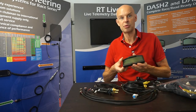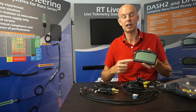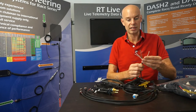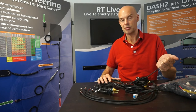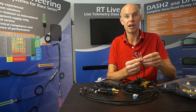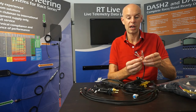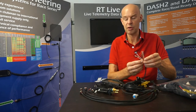The Dash 2 and Dash 2 Pro are both road legal. We have LEDs across the bottom for things like indicators, full beam, and handbrake switch as well, and those are brought out to these wires. For race applications that can typically be disregarded, but for road legal applications — for anything that's got to pass an IVA or an MOT test — these are wired onto the car. It's just brought out as wire tails, but they're very straightforward to connect up.